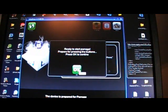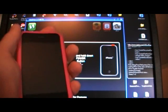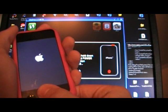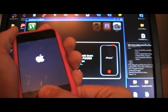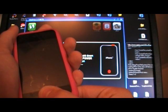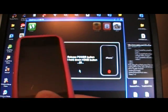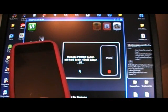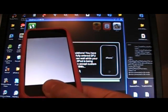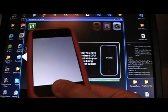Once you click OK, we're going to start counting down. Here we go. Pressing in the power button. Now you're holding both buttons in. Now we're going to release the power and keep holding in the home button until it tells you to stop. The screen should go white. If it doesn't, it's fine — it should still work as long as you did it right.